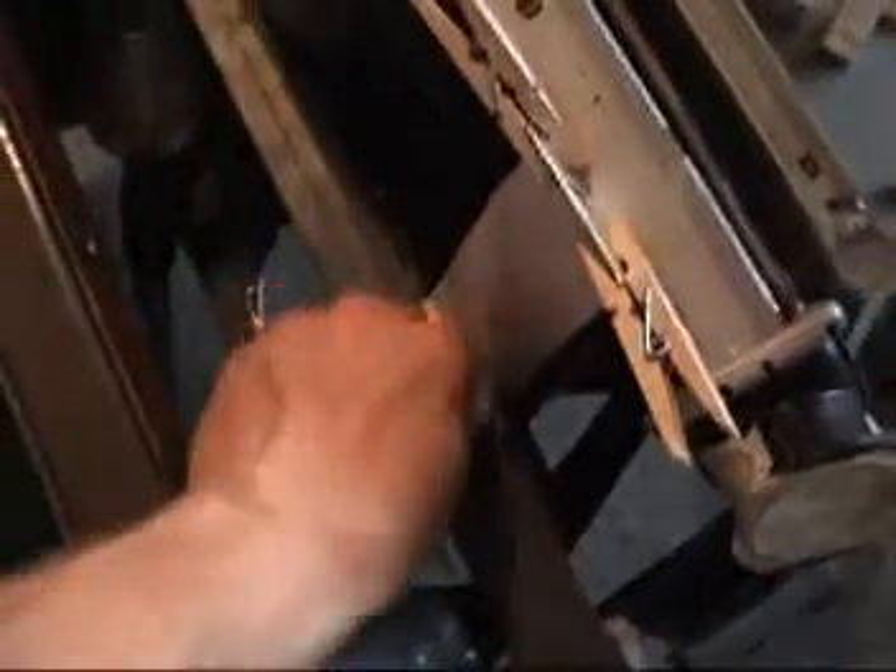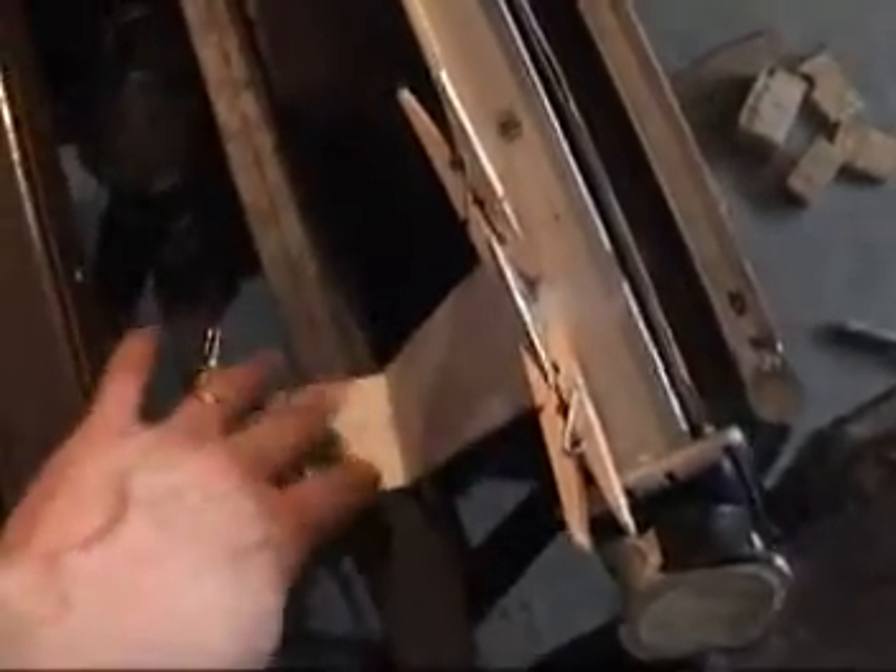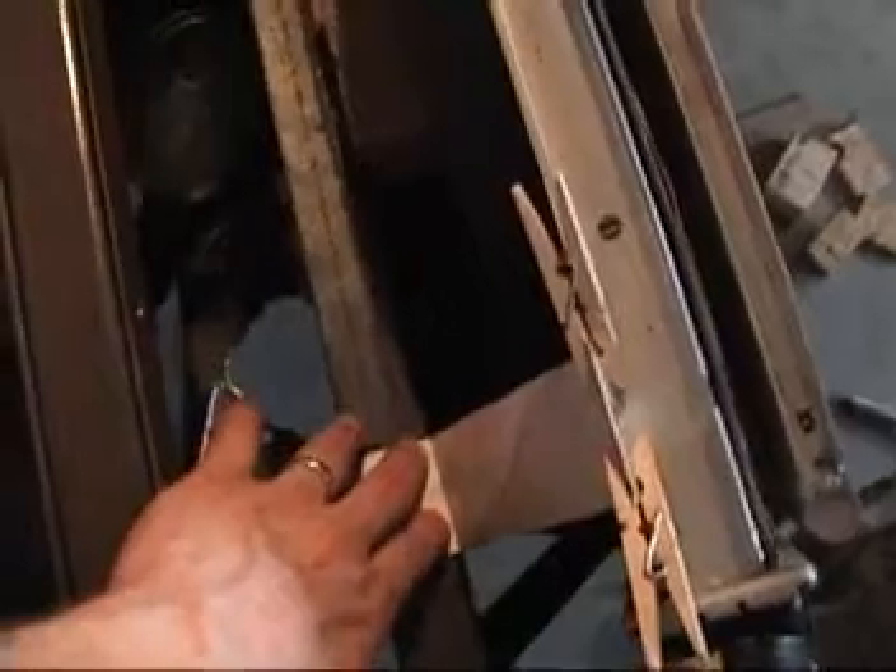I have to connect the radiator somehow to the frame at the top, so I'm planning out the brackets for that. With the front all tied in and tight and everything pretty square and straight, I've got to build some mount supports for the top. I've cut this little piece of poster board and I'm going to come down to this cross member with it, get these cut, and then I'll probably have to put some kind of a little web on the back side to stiffen it up a bit. We'll see how it looks when I get it cut out and put on.